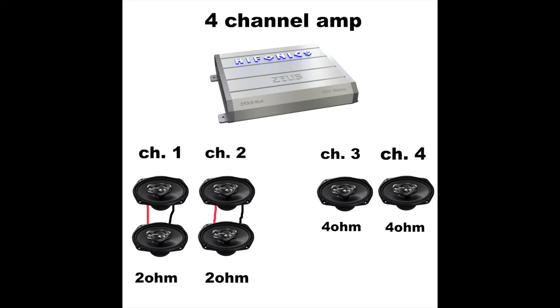So let me elaborate. I have four speakers in the car connected to the doors and the rear deck — those are the factory replacements. The two front door speakers, driver side and passenger side, are connected in parallel to a 2-ohm load and connected to channel one. Then the rear deck speakers are also connected in parallel to a 2-ohm load and connected to channel two. So four speakers only taking up two channels, which leaves channels three and four available. That's where I'm going to connect these two new speakers — and I'm not going to connect them in parallel, I'll let each one use its own channel separately. This is where the balance feature comes in handy. If I switch it to the left side, it's only going to play channels one and two. But if I switch to the right side, it's going to play channels three and four, which allows me to test out my two new speakers.